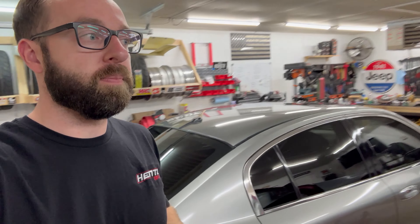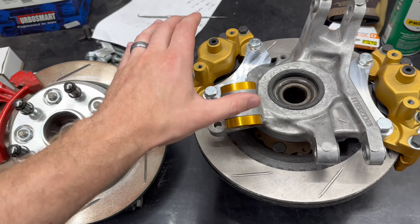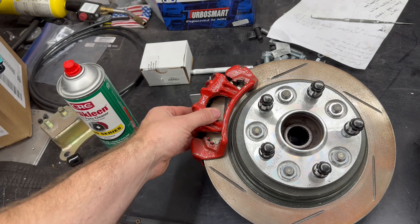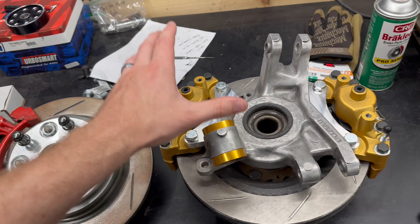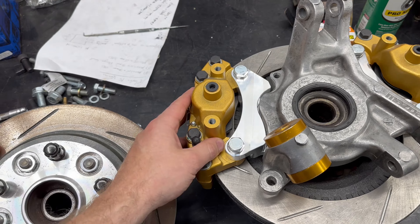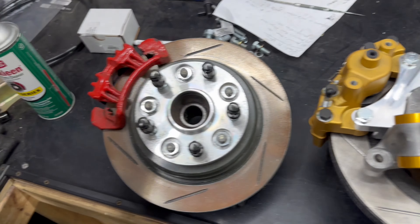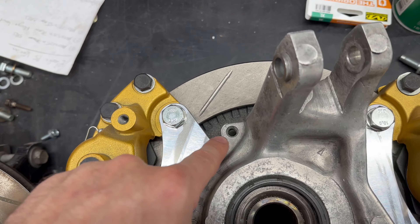In the meantime, I do have one video I want to put out featuring a new exciting product. One big thing for me with the FC is that I really like the Z32 calipers made by PBM, and I wanted to get away from the OEM single-piston caliper setup. So I've designed a new dual caliper setup for the RX7 that also replaces the foot brake. I've got machined brackets that bolt onto the front of the knuckle and adapt Z32s for both the foot brake and the hydraulic handbrake side, completely ditching the OEM calipers.